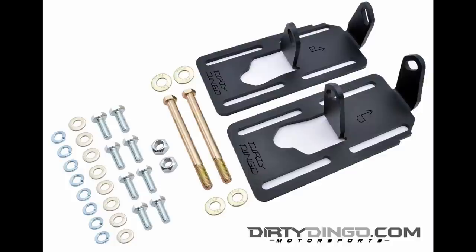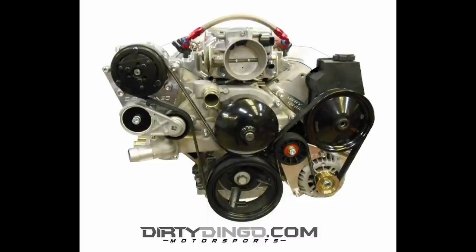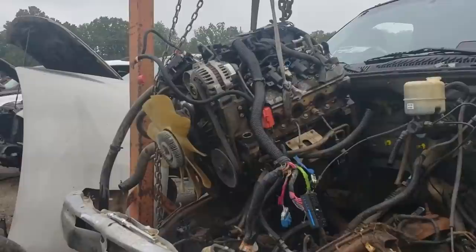On accessories, the key thing to know is 'car spacing' versus 'truck spacing' — that refers to how far forward the water pump pulley protrudes, which affects overall engine length. In tight applications like a C3/C4 Corvette or someone LS-swapping a Chevette, you want car spacing, though you'll pay more for those accessories unless you started with a car engine. Bracket companies like LS Simple, Dirty Dingo, and ICT Billet all make whatever you need — whether you want to run your stock AC compressor, high-mount the LS AC compressor, or add a power steering pump. All you really need to know is what spacing you're using.